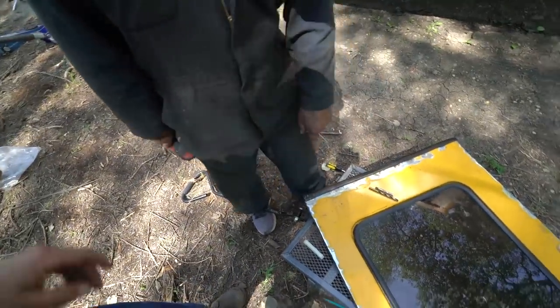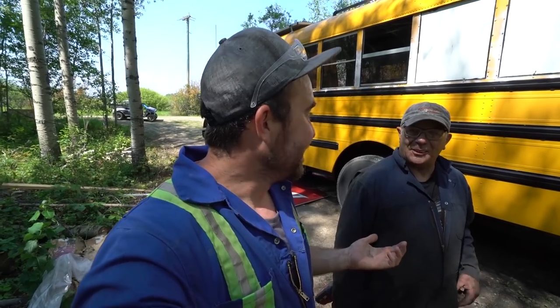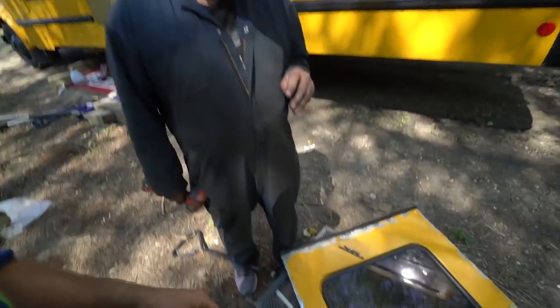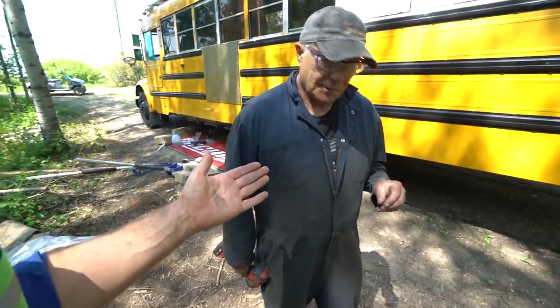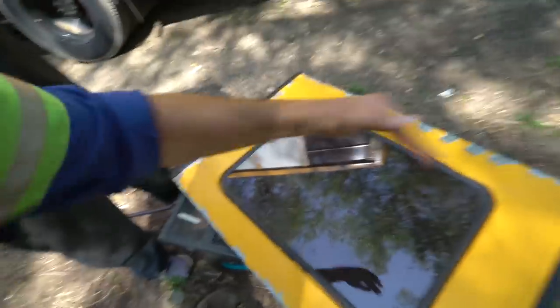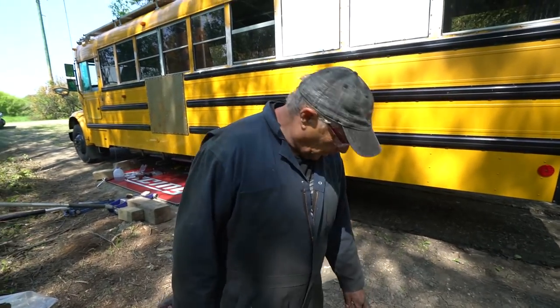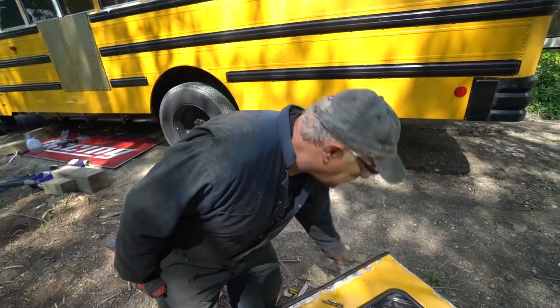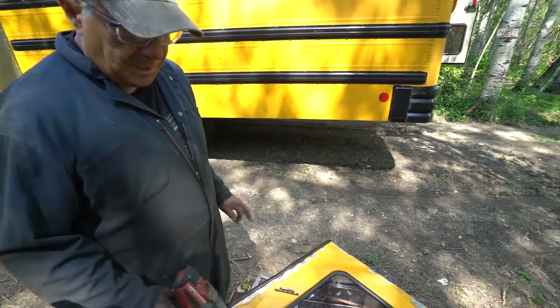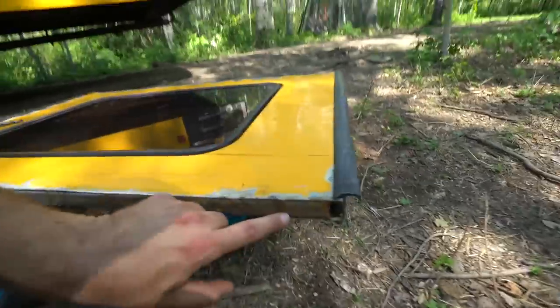But you didn't tell them that you put a piece of metal in there. When I was out running errands — and by the way, town is an hour away — these nice gentlemen were out here working on this thing. They put in metal this way and metal this way, because remember the door cracked on the bus and was all cracked up? So we welded the door and put in a reinforcement with two one-inch bars. Basically the door is just a skin now — these doors are just hollow and super cheap — so we added a square reinforcement that goes over and around.